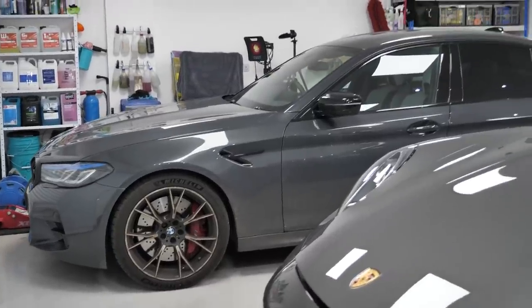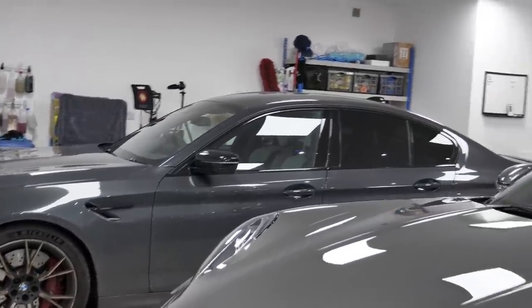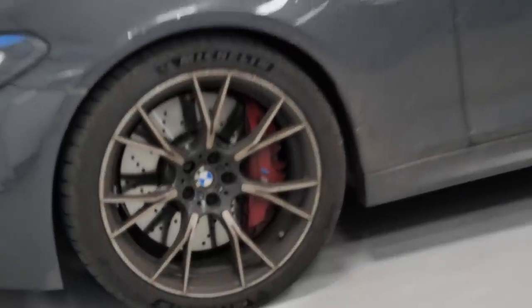And once the car's complete, of course, going forward, it wants to be correctly maintained to really get the most out of the coatings. Often some people think that, great, the car has a ceramic coating, so it's this invincible barrier now on the surface, so they can relax a bit and not stress too much about maintaining it and washing it. But no, very much so, it does still need probably more maintenance to keep the coatings fresh, to keep them responding and performing as they should be. Whereas if the car's allowed to get into this condition with the coating in place, yes, it's still under there, but it's become suffocated, it's become heavy and saturated with dirt.